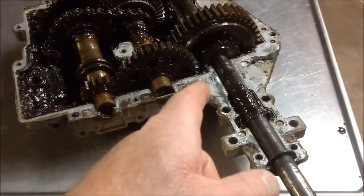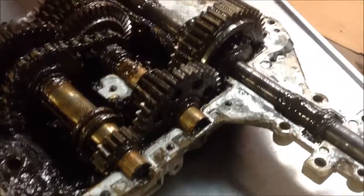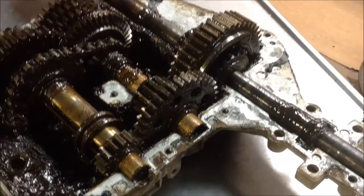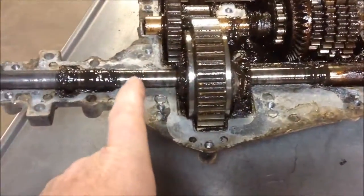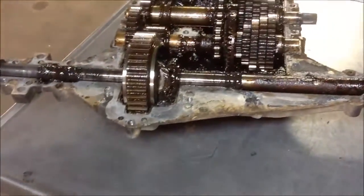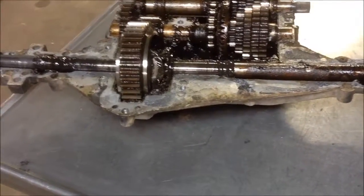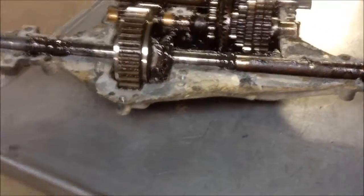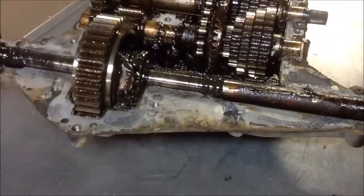And then once I've tacked it in place, I'll bring it out and I'll put a pretty good bead on it. Now, the thing about that is you want to get it cleaned up. We have had our race director try this. The first one he tried, he clamped it so that it wouldn't move. When he did that, the clamping actually tweaked it, and once he put it back together, it made it spin untrue. So every one that I've done, four of them, and this will be number 5, I've just left them in there floating, just like that.